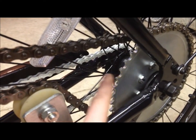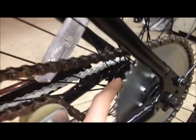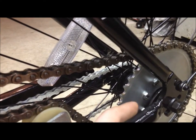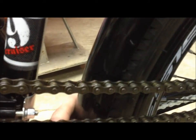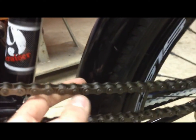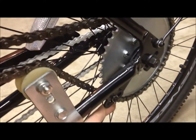The next matter of business is after you get this all tightened down, you want to straighten and line everything up. Usually you're gonna want your sprocket teeth — they have an offset — you're gonna want those to be offset to the outside, like I have it here, because it's gonna have to clear your wheel and your fender. You can always take your fender and kind of bend it in with your thumbs to get it to clear your chain, like I have here. That worked out pretty good — clears the fender real nice.